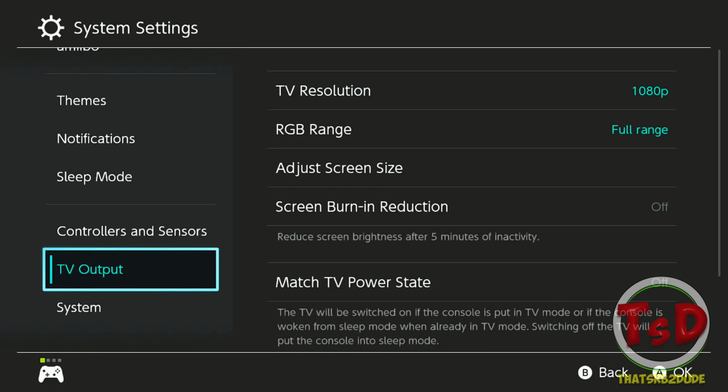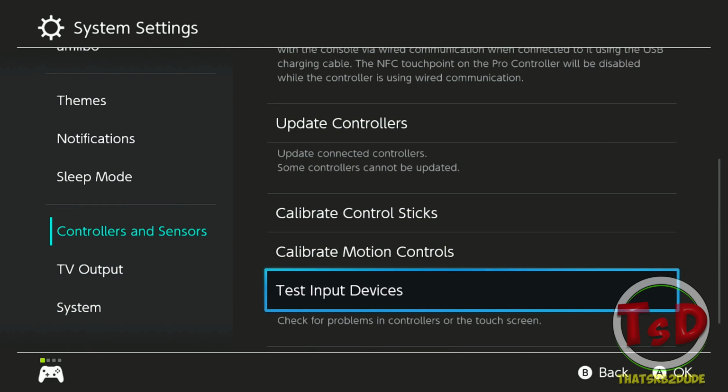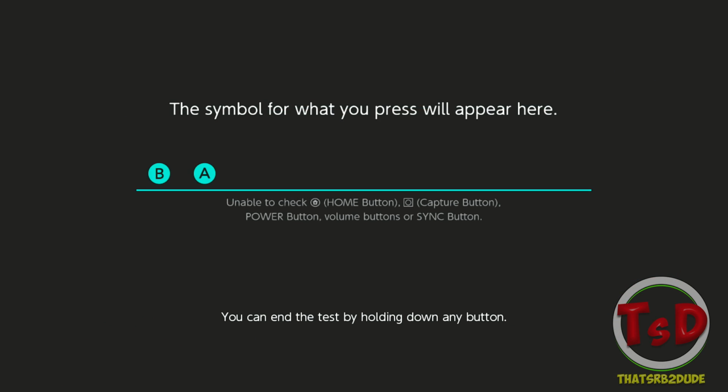Once the band has been clipped back in, I would suggest that you put the front of the controller on properly, put the battery into the back of the controller, and just turn on your Switch and probably go into Nintendo Switch settings to just check that all the buttons work still. I'm not saying this just to scare you, but it's just to make sure that you put the band back in correctly, which honestly isn't so hard. And once that's done, you can then go ahead and screw in all the bolts that you previously unscrewed.